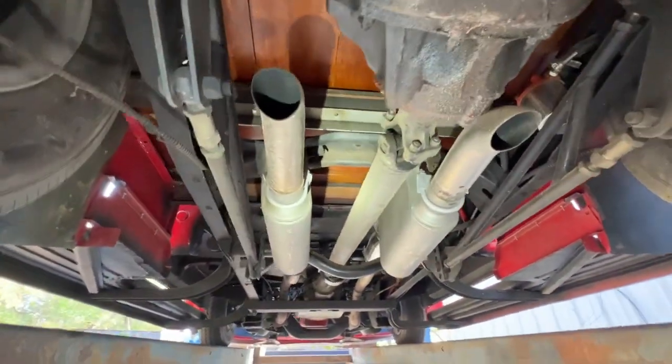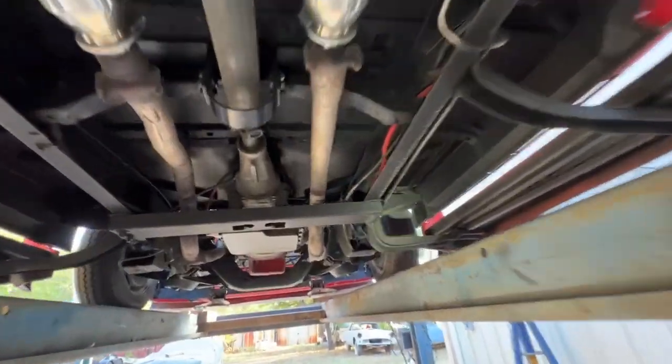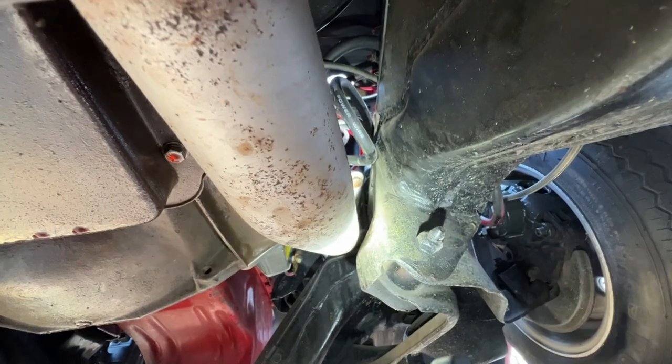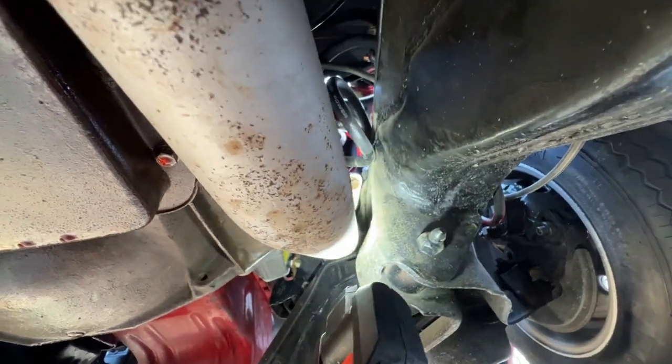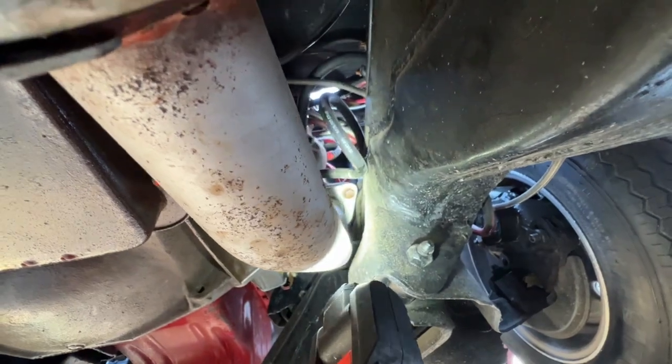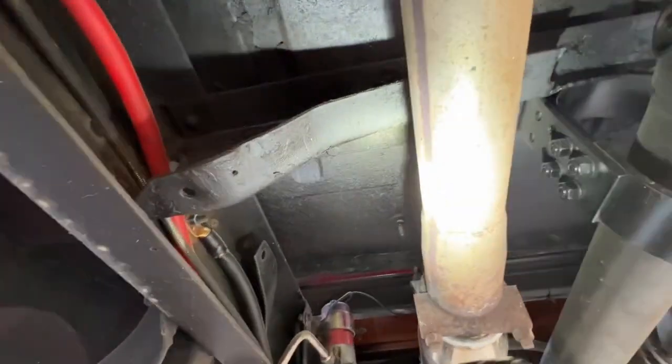There is a vibration in it, and that was the front exhaust right here at the frame. It was hitting. This was all the way against there. I put a pry bar up in here and pushed it away. I don't know if it's going to stay. It may need some exhaust work to put some hangers possibly that keep the pipes pulled in one direction.